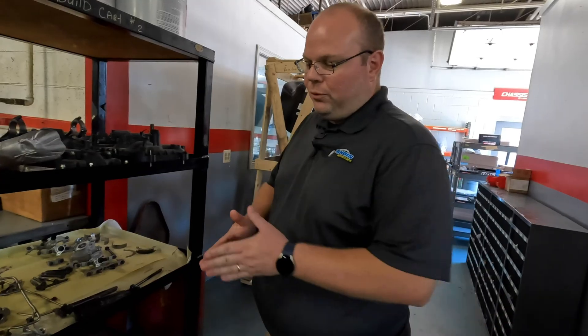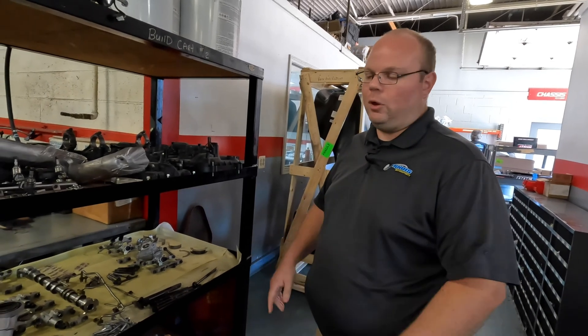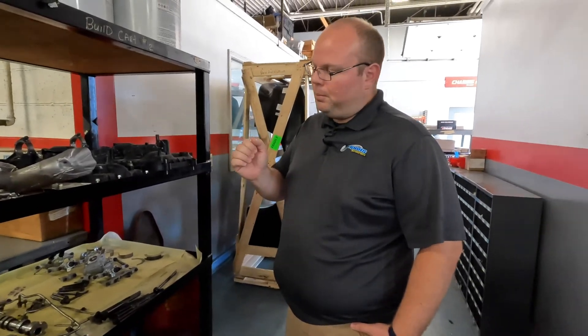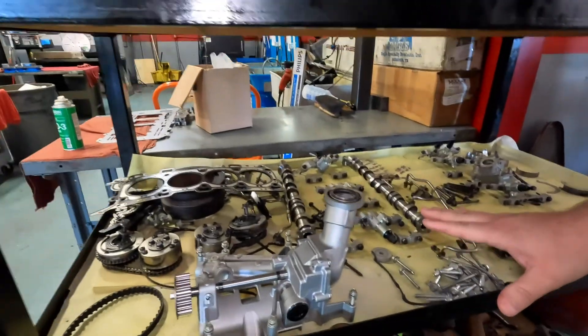For a little while, the F-150 5.0 and the Mustang were sort of lined up. Then they started making changes — camshafts, speed density versus mass air. The Mustang went mass air and the F-150 went speed density, sort of old school. That's still true, but there are a lot of differences now beyond the firing order and the basics we've gotten used to. The oiling system is different.